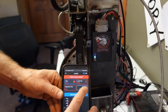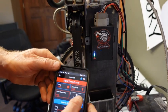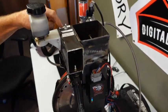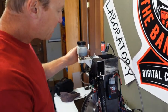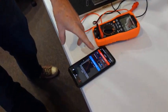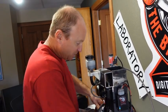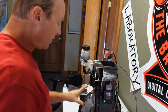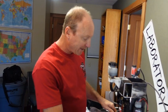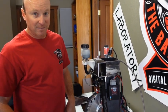When you hit it, it's going to flash. Master switch on, master switch off — you can see the green light here flashing on and off. So we're going to go ahead and utilize the master switch. I have it set up here on a toggle switch. In your car, I'd like to see you have a momentary switch, very similar to the clutch switch, but on the steering wheel — almost like a trans brake button. The way that will work is if you have it off but have master switch selected on in the app, when you cycle the clutch, nothing's going to happen. It will not activate again until you have the clutch switch pushed and you toggle the master switch. That's how the master switch works.